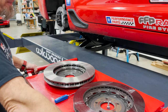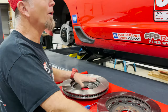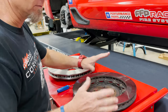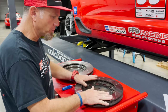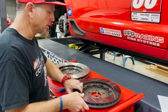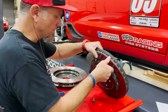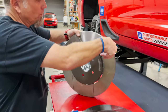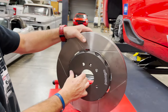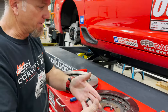Do people in the street use these snap ring style kits as well, or is this more track-oriented only? The thing I like about the snap ring style is it is quieter. Once you get about 150 degrees into the brake system — which is very quick — everything expands just enough so you don't hear any rattling. But you can tell there's just a little bit of rattle before that, so in street cars this application wasn't the best thing. Whereas this setup — we're doing some street kits with it — because of the way it's retained, it doesn't rattle. So it's a lot better system for guys that are going to be doing street cars that also maybe take them out to the track.